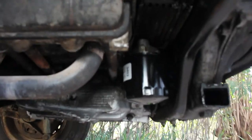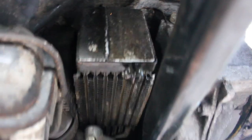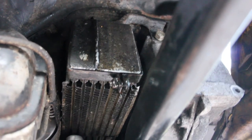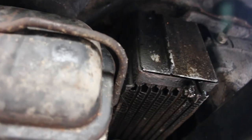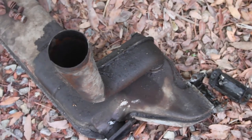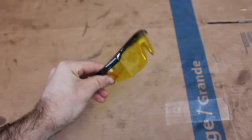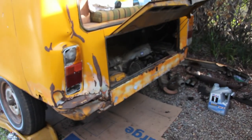It's now actually another day - just working on it slowly, day by day. I think what we've established is there's definitely an oil leak dripping off there. What I found out is that is the oil cooler. I ran the engine and definitely have dripping coming off of there. What I'm really going to do is clean up this oil cooler, and then I have this little bottle of engine dye. We're going to throw this into the oil, and with a UV light and some special glasses, we're going to hopefully locate where this leak is coming from. We know it's coming from primarily up here - I think the heat exchange box was right up in here and oil was just dripping onto it. It's all covered in oil up in there. Even though you don't necessarily have to clean it up first since the UV dye will show where the leak is coming from, we have our fancy glasses and UV light. We put the dye in the oil and flushed it down with a tiny bit of fresh oil. Now we're going to turn on the engine, let it run for a sec, and then start looking for that leak.